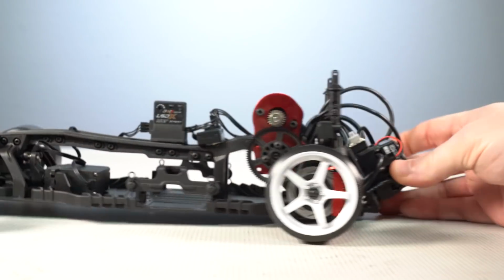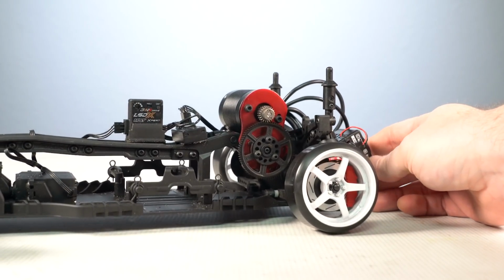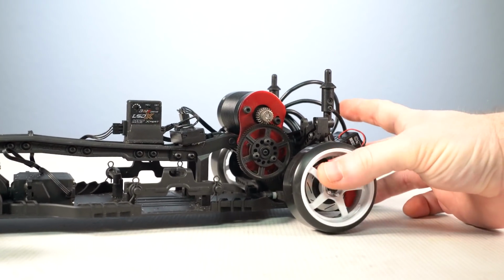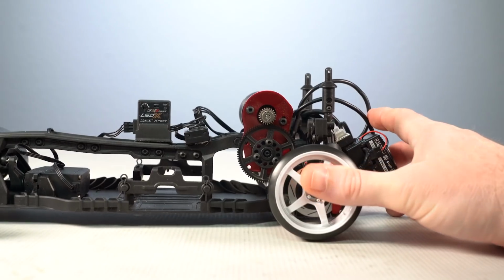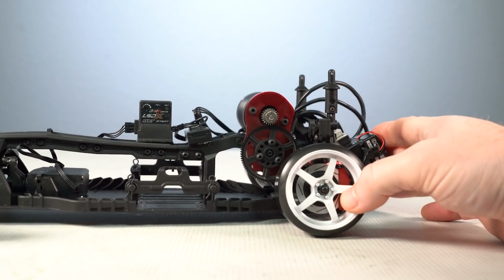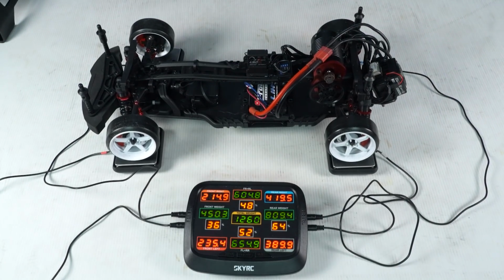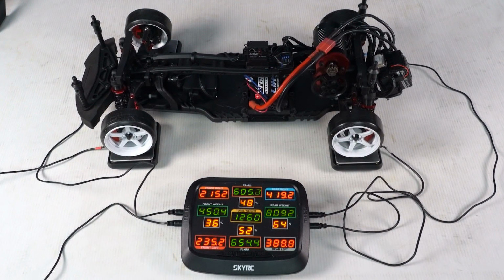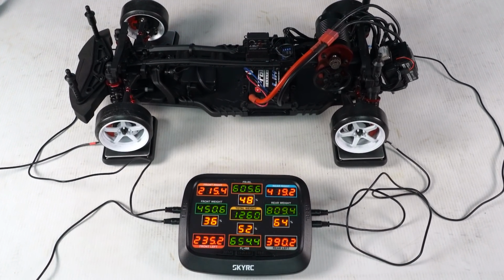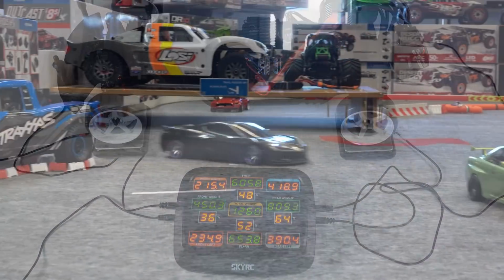Now we put the motor in the straight up position, which actually places it further back in the chassis, which should also affect our weight distribution. So let's weigh it again, but only after we reset that ride height and camber again. With this simple and free modification, we were able to remove another 1% of weight from the front and stick it in the back. So let's try the car.